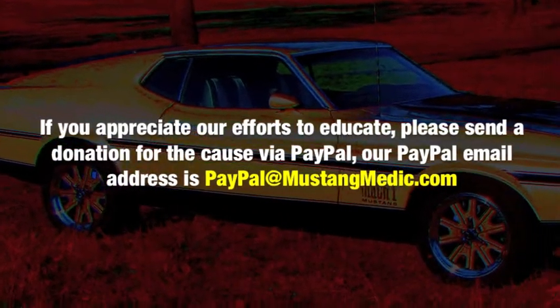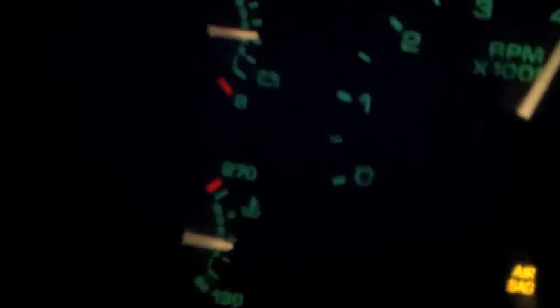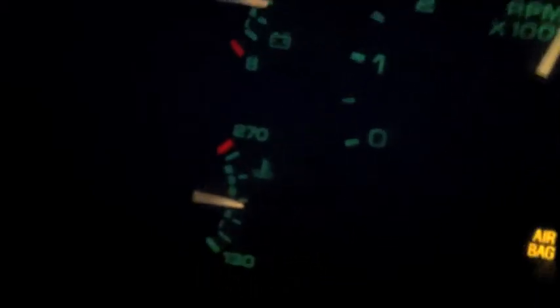Alright, night-time video. Test-driving the '92 LX. This tachometer is stuck at 4, so at idle it shows 4 — the tachometer is just not accurate at all. We have let it idle for a little while and the temperature is on normal. We are going to run her at 67 miles per hour and see if she sits in 4th gear and how the temperature holds with the new thermostat. Sorry for the vibration and blurry screen, but that is a successful thermostat opening and the car is not running hot. Transmission is slipping though — we need to look into why it's slipping at 45 mph. But the temperature has been fixed and she is running cool even with all the slipping. Boom — good news.